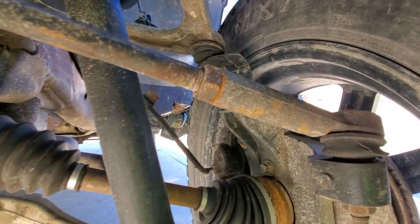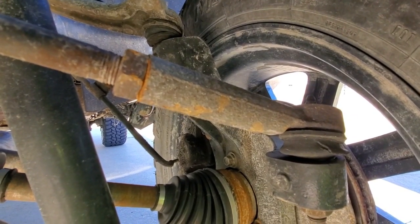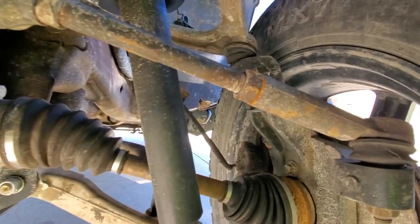You do have to cut the old tie rods. They give you a chart, and I think it's 3/8 of an inch. Cut them, they go right on. You have plenty of adjustments still.